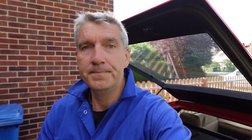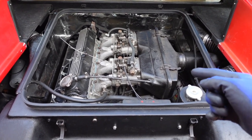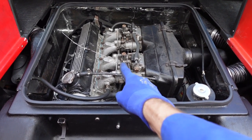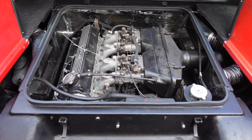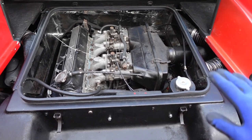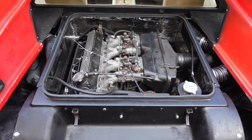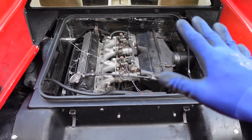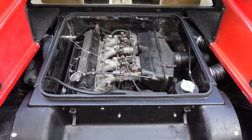I'll then need to try and balance up the carbs front to back a bit more. I'm going to have to take off the airbox cover and move the ducting out of the way, and I'm hoping I can get to the nuts underneath without having to remove all the engine surrounds. It's one of the strange things about the S3 — when it was built up it made life a lot harder for maintenance.